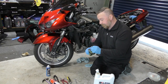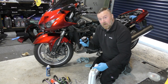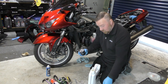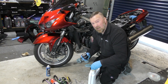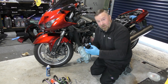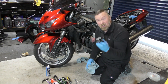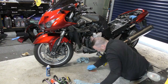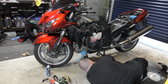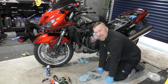Next, oil filter — air flow, high flow. Nice and easy. Little bit of oil on your finger, run it round. Nice fresh oil. Put it back on as hand tight as you can get it on. Do not use a tool to get it off and over-tighten it — you'll have the same problems trying to get the damn thing off, and it's not fun. Nice and easy. Cloth. Simple as that.